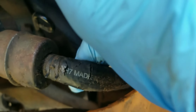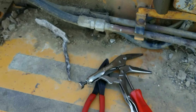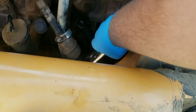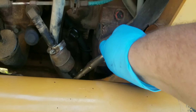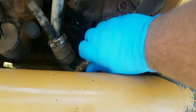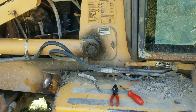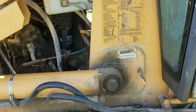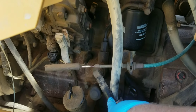Just looking at this fuel line — it's all cracked. It goes down inside the frame rail, comes back up and out to the sending unit. I'm going to use some needle-nose vice grips to cap off the fuel line. I'm guessing it's dry but I don't want it leaking. I'll take this little section of line with me to the parts store and pick up probably seven feet of hose to make sure we get enough. Fuel line is cheap and we're just going to run all new hose up to that priming pump.